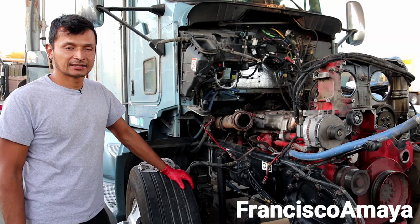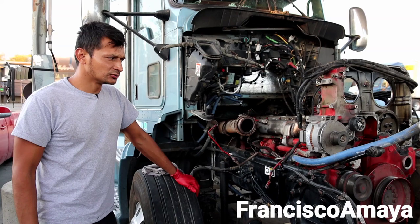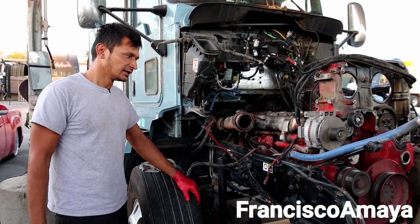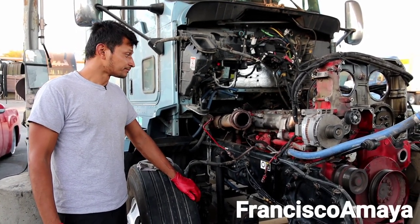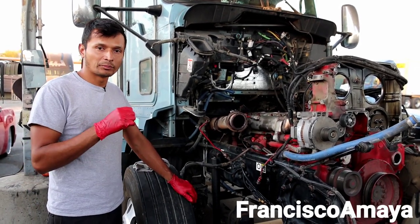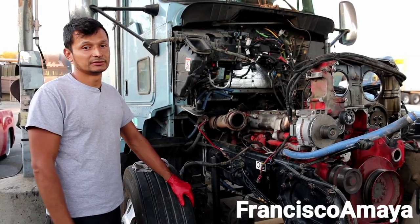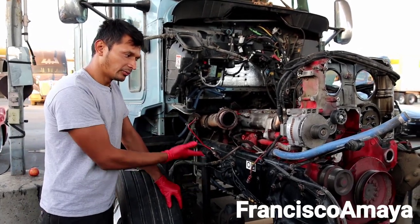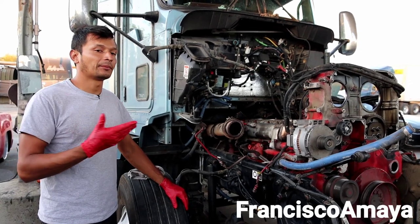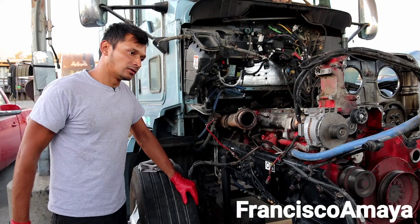Keep this in mind: if you start feeling low oil pressure on your Cummins ISX regardless of the year, I'm not sure if this applies to the newer X15 engines but I believe it's similar since the engine technology is pretty much the same. As soon as you see low oil pressure, the best thing to do is replace all the bearings — cam bearings, main bearings, and rod bearings. You don't know where the problem will be, and you don't want to replace rod bearings only to find out later the cam bearings were also worn.